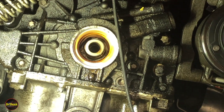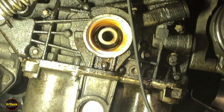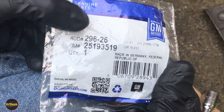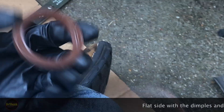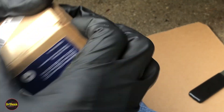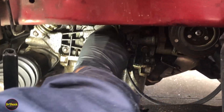We've got our seal cavity all cleaned up. There will be some amber varnish color — what we want is the surface area where the seal is going to sit to be clean. Here's our new seal — an AC Delco 296-26, or GM 25193519 — it looks like this. Simple seal, and the old one is right here for comparison. This gets installed with a seal driver. I have an OTC one, which is a knockoff of the GM one specifically for these engines.